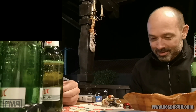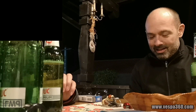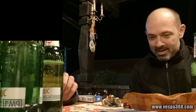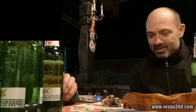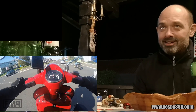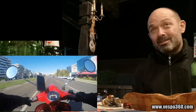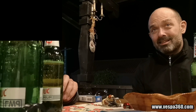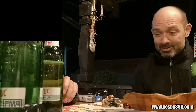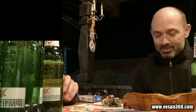It was a pretty good day. My own bike is finally kind of dialed in correctly and it performs extremely well with everything except full wide-open throttle — I still haven't figured out the jetting for that. But aside from that, it's great. Very, very pleased with the Molossi 221 Sport, which was actually the 210 with the 1.5mm head gasket. It's got more power than I need, it frightens me, and I'm pretty pleased.